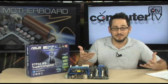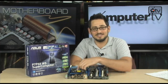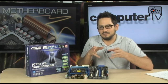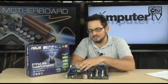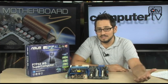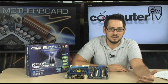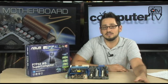But that's where you'd be wrong. The problem is that although you have 32 lanes, you're actually only using 16 lanes' worth of bandwidth — the chip is bifurcating that, spreading the PCI Express out. So you're still limited by the bandwidth going into the chip through the DMI. That wouldn't actually help for a gaming-type system, but it would help in a Tesla-based system. This is really, really good for a workstation with multiple Teslas. It's not as great for an SLI or Crossfire setup, but it still works.